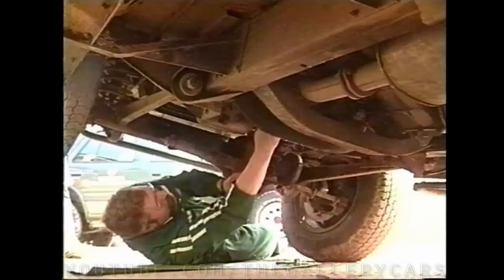Now the other wading plug is being screwed into the drain hole in the bell housing for the same reason. All Land Rover products, whether four or eight-cylinder models, have a drain hole here. Always remember to remove the plug or plugs after crossing deep water so that any water that's entered the housings can drain out. While underneath, make sure everything looks in order, including the remote axle breathers fitted to all coil sprung Land Rovers, Discoveries and Range Rovers.